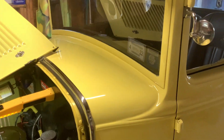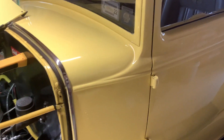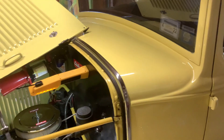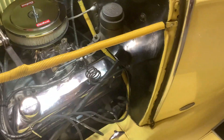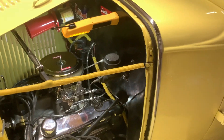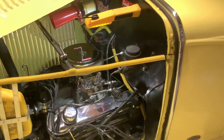It's looking like valve seals. When I pull the spark plugs — I don't think I have them here — they weren't burning bad, but there was one cylinder right here that was a little wet, so the valve seal may be cracked on that. And there's actually a lot of gas still in the oil, so I'm going to change the oil tomorrow.